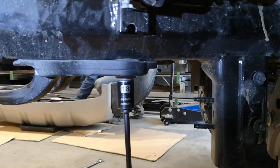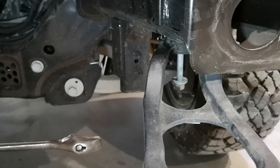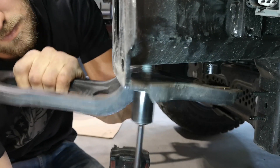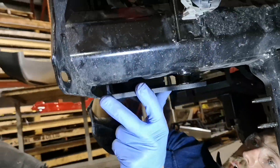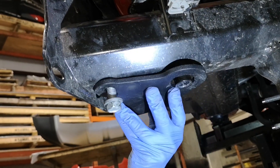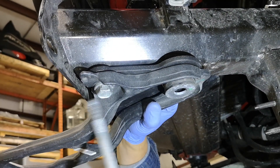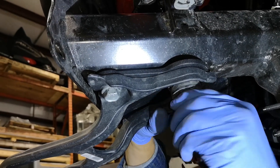Grab your 18mm socket and remove the fasteners holding the back side of the tow lugs, which also attach to the body mount. They're suspended with a retaining washer — grab a metric crescent wrench, size it to the bolt, and whack it loose to bend the washer over and let the bolt drop. Then grab a 21mm socket to remove the last piece of hardware. Slide the driver's side frame bracket underneath the front frame, grab your M14 hardware, start threading it, and slide the tow hook over the threads. Snug it up finger tight, then thread in the M12 fastener and snug it so the assembly stays together.